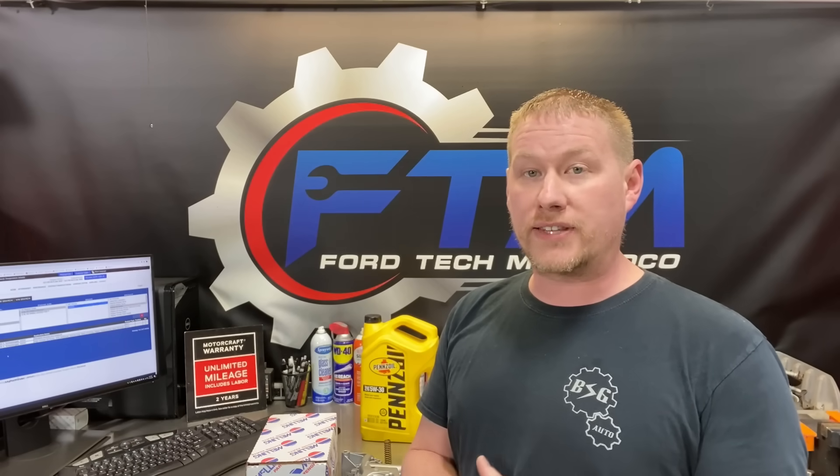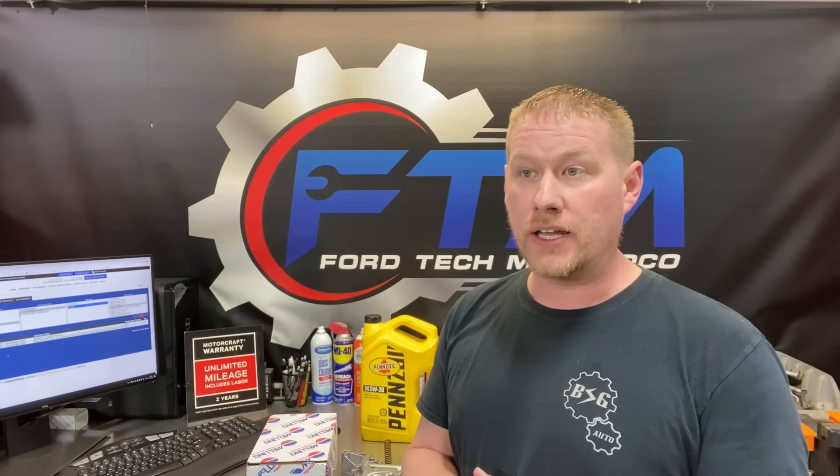The great part about this pump is that it covers a lot of miles and a lot of years. For instance, from 2007 when this engine was first introduced in the Ford Edge, it applies all the way up until 2020 in the Ford Flex. So you can see it covers a lot of ground. Just about the only engines it doesn't cover is the second generation 3.5 liter EcoBoost engine, first used in the 2017 Ford F-150.